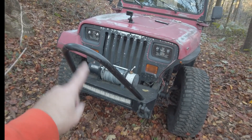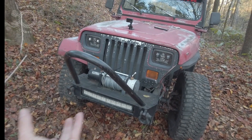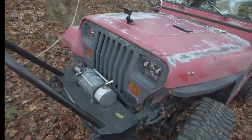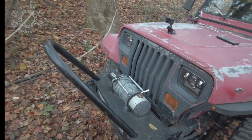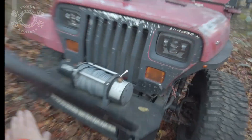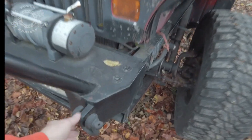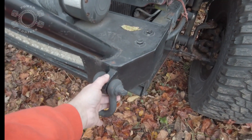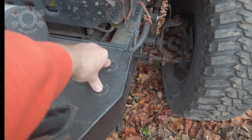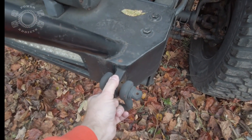Along with making the fairlead mount, I've thought about altering my stinger hoop because it just looks weird sticking out like a flat tongue. Maybe if I add a grill hoop across the front, with a brace, it wouldn't look so odd. Or I might cut it off completely and shorten it to just a bull bar above the winch. Haven't made up my mind. When I fabricated this bumper, these side pieces tie directly into the frame — they're not just welded to the shell. Everything here is made from scrap 3/16ths plate, bolted and inserted directly into the frame.